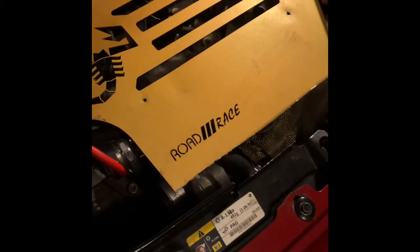So I had to pull the turbo off, and in the meantime I was able to get a line, which I didn't have before, on the compressor housing. I don't know if I can get enough light, but you can barely see it down there. Now that it's on the compressor housing, I'm getting more accurate boost readings than before. It plugs right into my boost controller right there, and that is an electronic boost controller by Greddy. It's a Profect, and it's great.